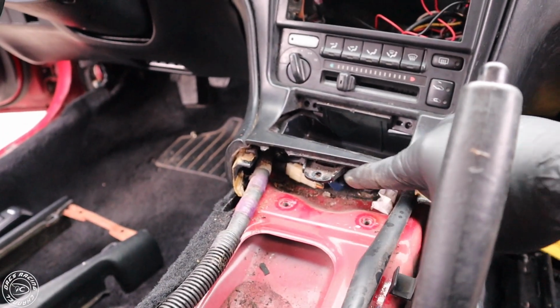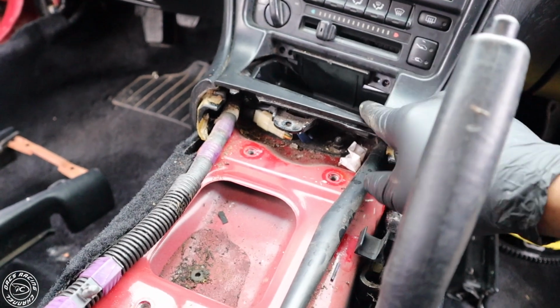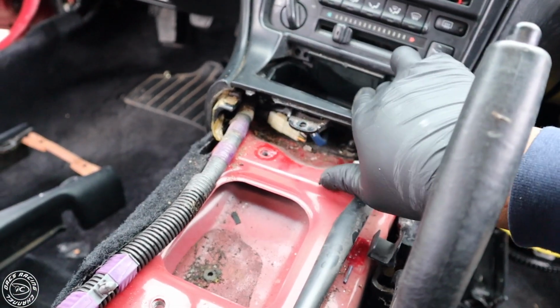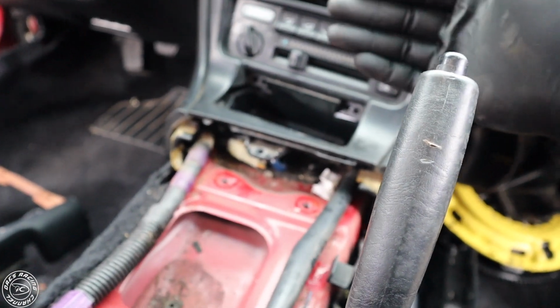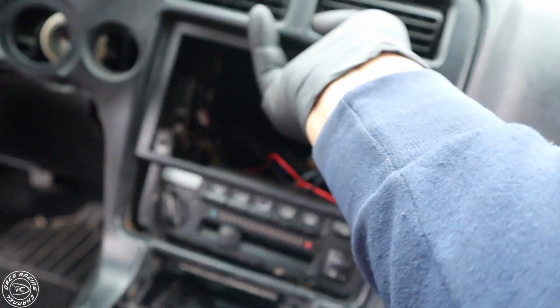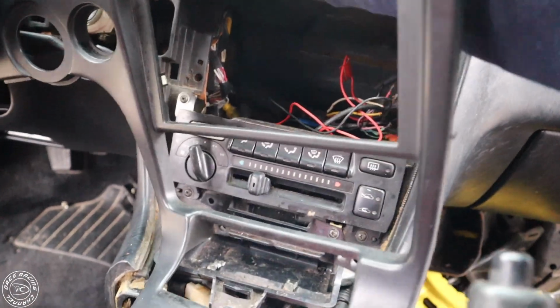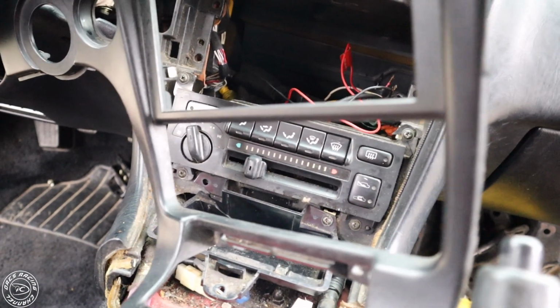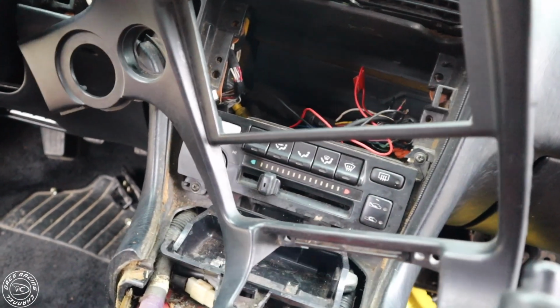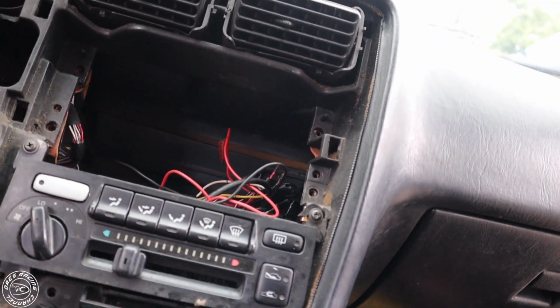So you screw this little part off right here that goes around this, and it keeps the other center console in line. So this will all pop out once you take these screws out down here. They're normally here, and I don't see any screws here right now. So this is just going to pop out. You're just going to grab it and pull it out just like that. It's hard to do with one hand. You just pull this out. You disconnect the emergency signals, the 4-way flashes, whatever y'all call them, depending on where you live. You get the 4-way flashers disconnected back there, and you can pull this out. You set this outside the car, set it in your driver's seat, passenger seat, whatever it may be. Now you're going to disconnect this ashtray.